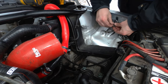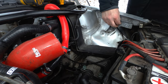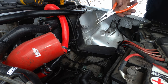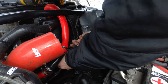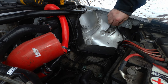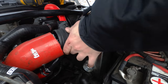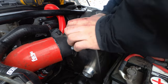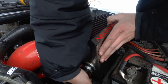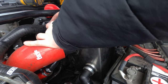Some people would say no and some people would say yes about the pressure relief valve. While I decide that and wait for a new one, I'm not going to run mine — mine is too far gone to run right now. With this setup it's incredibly easy to add: just put it between the black hose that connects to the tip and the red hose that connects to the catch can. For the drain hose, I figured it would be easiest just to cap it and route it near the side of the intake, then all I'd have to do to drain it is remove the intake, unzip-tie the hose, and put a little can in there.